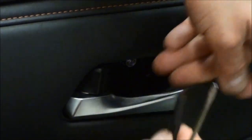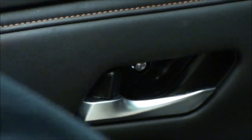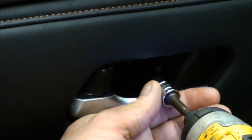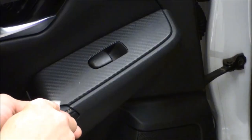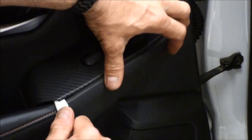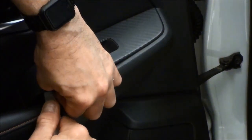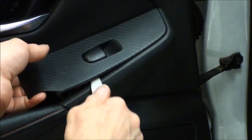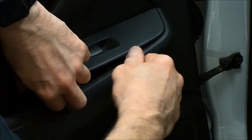It's also got that little piece there, so when you put it back in, make sure you put that first side in and then snap it into place. You have a 10 millimeter bolt right here, also with the Phillips head. Next step is to take the switch off — get under here and just kind of pry up gently, help prying it up with your hand once you get that part off, and then just work your way forward on the switch.